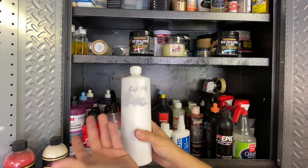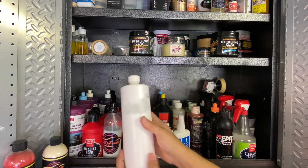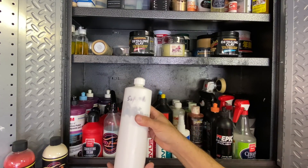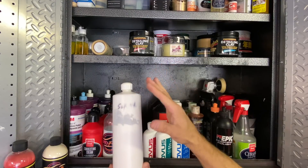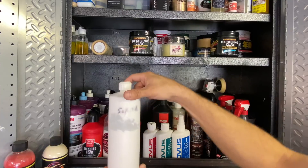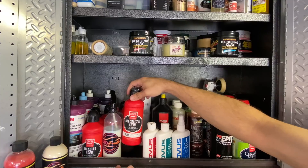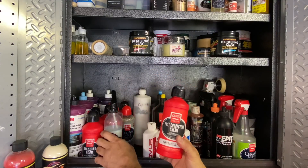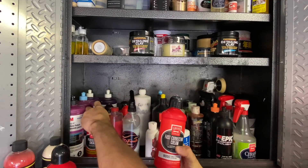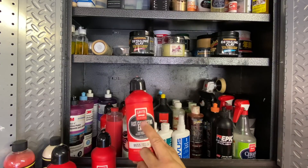I love the 3M EX compound - great for color sanding on single stage paint or a very hard clear coat. It finishes out well. It's expensive - around $45 to $58 per product - but this is professional grade. I use it with rotaries, specifically with a Flex 3401 and my professional rotary equipment. I don't use any of this 3M stuff with dual-action. This is specifically for aggressive repairs.